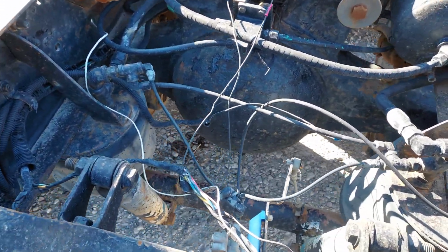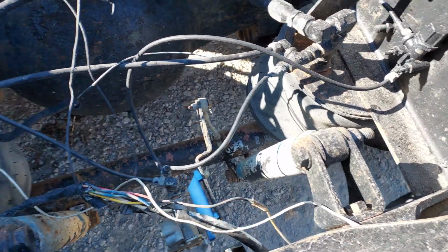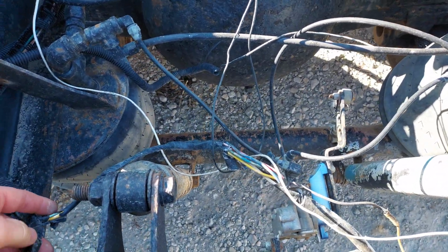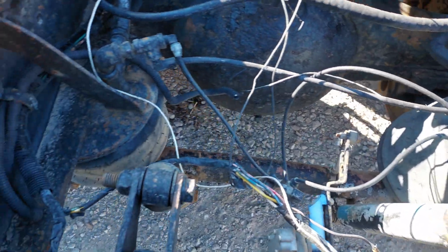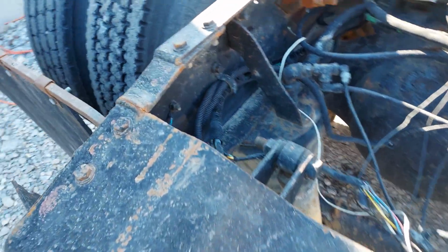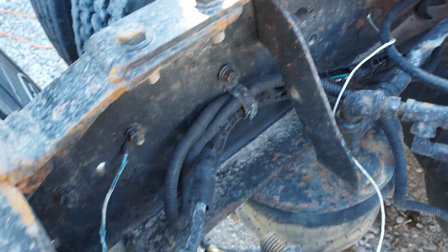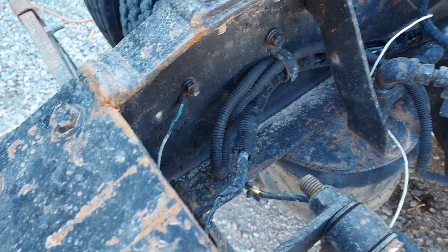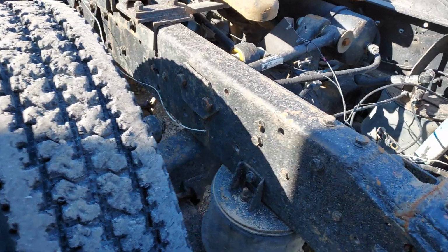And like I said, the wiring harness has just kind of been hacked up over the years. So this was the tail light wiring harness, and obviously once you get to about back here, somebody's been hacking on it. So get that all replaced. The looming's starting to deteriorate, so once I get the wiring harness all sorted out, put fresh loom on it, get it all back up in the frame how it should be.